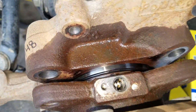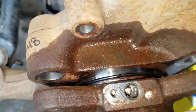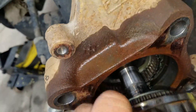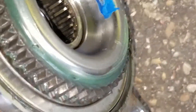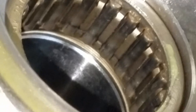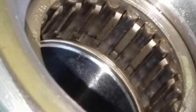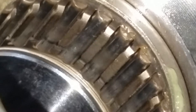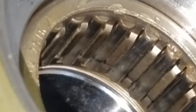These particular hubs have O-rings, so that's helpful in some cases so that when it comes time for it to come off, it's not stuck big time. That's how that thing comes off. Now, if I look at this needle bearing in here, it's got a little bit of trouble in it. You can see that line in there — that just may be the line where it sits at on the armature. The CV shaft comes out and it rides on that little bearing, and that just may be where it rides. For the most part it looks pretty good.